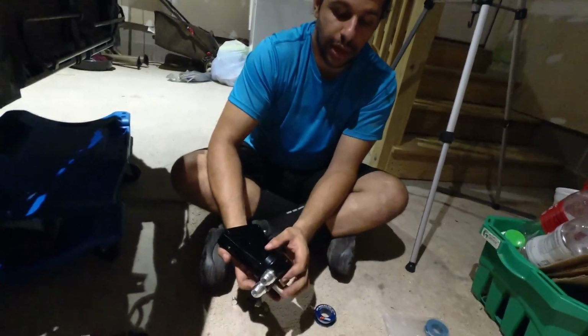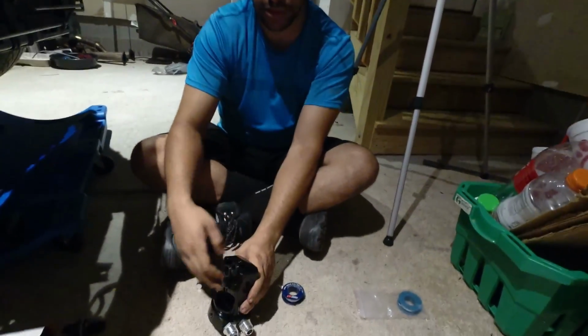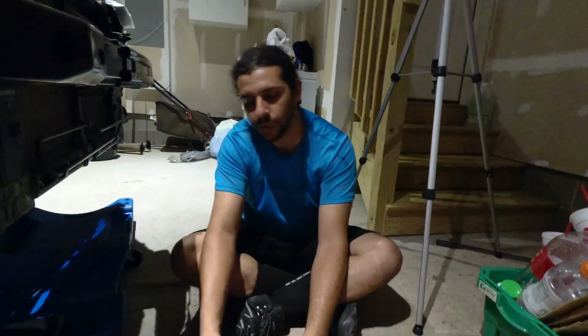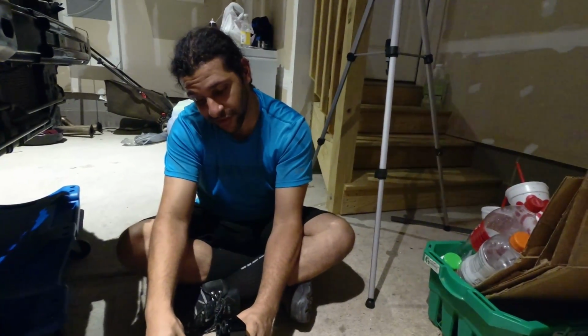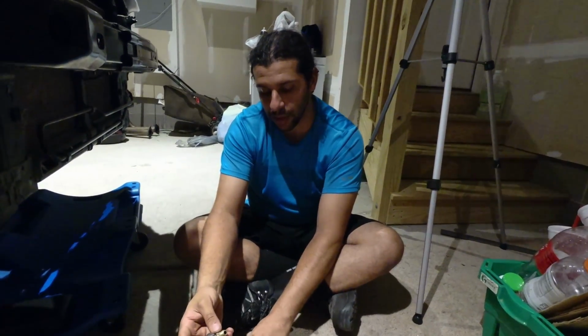From here, now you're going to install the 2 sensors for your gauges that you will be provided with from Remnant Performance or Performance Unleashed. I'm mixing both of them up, man. So these ones you need to Teflon tape, okay? Both sides.